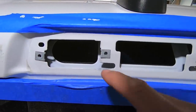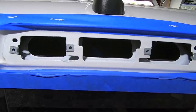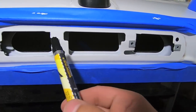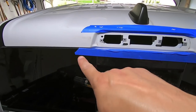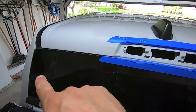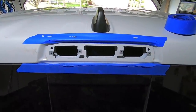The cutting is done. We trimmed the bottom of the ledge on each side and went straight up, giving us enough clearance. After cutting, I took an automotive touch-up paint pen in the body color and dabbed everything on the exposed metal — probably not strictly necessary but good peace of mind. Next we're going to go inside and I'll show you how to partially pull the roof liner down, because we need access behind the C-pillar to route the wiring.